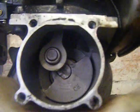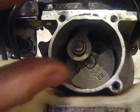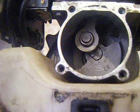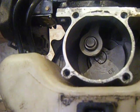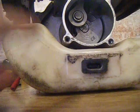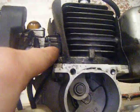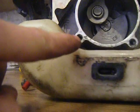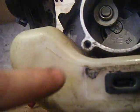On chainsaws, you wouldn't have something that can be removed like this, because a chainsaw has a full crankshaft — a flywheel and pull-start on one side, then a clutch going to the blade on the other. Somewhere underneath, about this position, you'll have a carburetor with a similar plastic fitting that bolts on, and in between there'll be one single reed. As the piston goes up and makes lower pressure in the crankcase, it sucks air through, and as the piston comes back down and compresses it, the reed closes, allowing the mixture to be compressed.